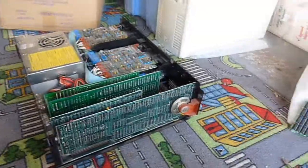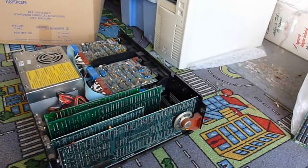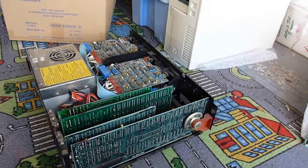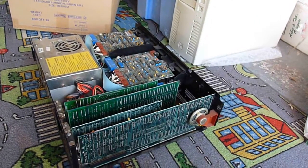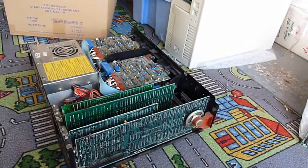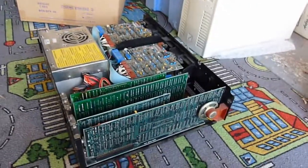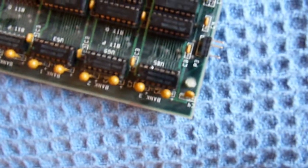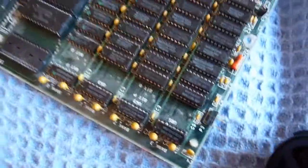The boards are taking ages to dry so we're going to have to fire this thing up tomorrow. I'm not firing it up while the PCBs are still wet because they could short circuit and make the problem worse. Thanks for watching part one of the IBM restoration - I don't know how many parts there'll be, hopefully max three. Just as a fun note, one of the RAM chips had two pins fall off, so I soldered on some replacements - just stuck some wire there, sorted. I'm determined to get this thing operational, even if I have to remove chips and check underneath them.